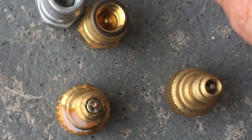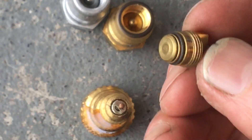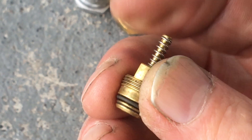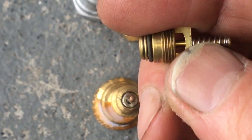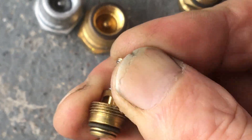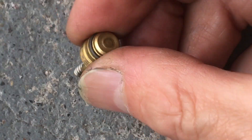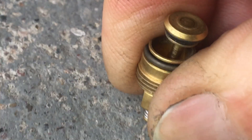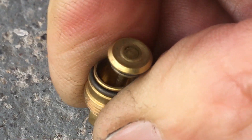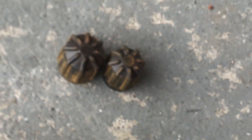These flow more than with the R12 core removed. That's how that works, and you have two of them. This is the size of the piston, this is the size of your opening, and when you press down on it — there you go — that is the opening. You see that? It's clear all the way down through, wide open. This is what happens when you push through these R134 fittings.